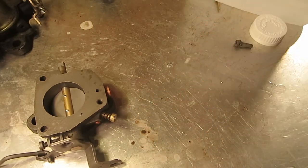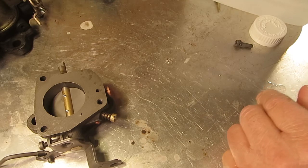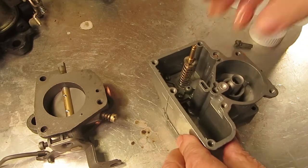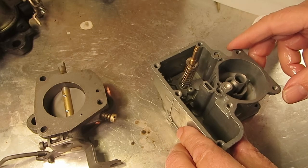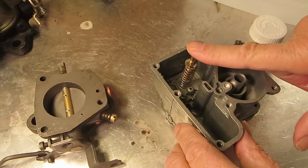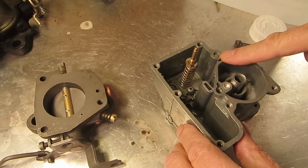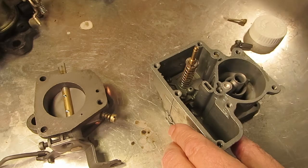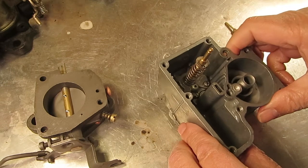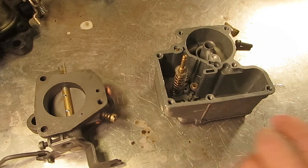And that one seems to work pretty good. This is a good way to test your accelerator pump before you put it back on the car. Before you put it on there when you're getting the hesitation, you need to go through those steps so you can figure out where the problem is. I showed you where the circuits are — you just want to be sure those are clean. The check ball is in here; the check weight and check ball, or just the check weight, depending on what you have. I think that should cover the accelerator pump part of it anyway. Thank you for watching — we do appreciate your business.